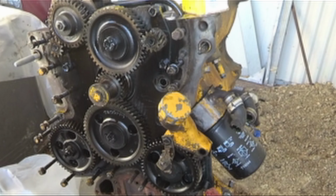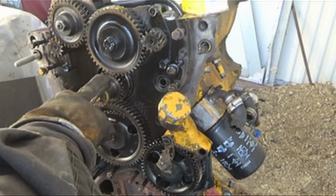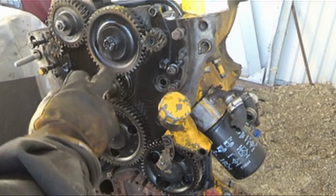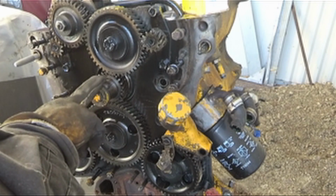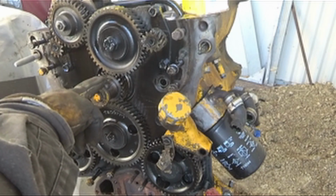So thanks for watching. Okay, we got the engine rolled around here upside down on the stand, and need to take up the crankshaft, which has this gear here on the end, and I want to make sure this goes in the exact way it comes out so I don't mess up my timing.